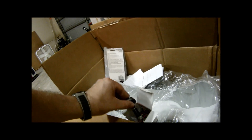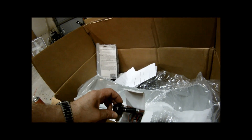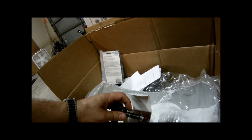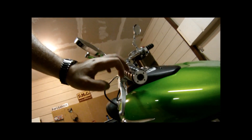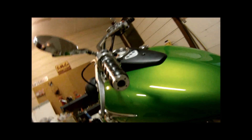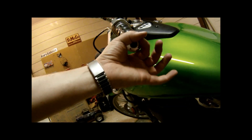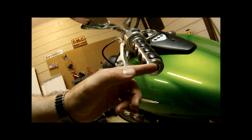Let me show you these bar end lights here. You can see there's a little taper down at the base - you stick your bar ends in, tighten them down, and they stay because this little rubber piece swells up. But that base at the bottom is flared out. These grips are actually aluminum with a rubber insert, and the end hole was too small, so I had to flare it out right there on the ends. Now when I put the bar end in, that flare on the turn signal will fit flush so it'll be completely flush with the bar end.